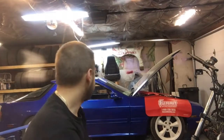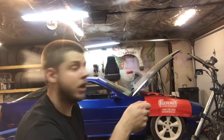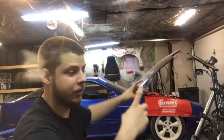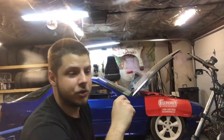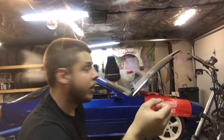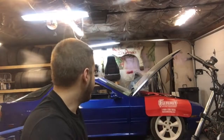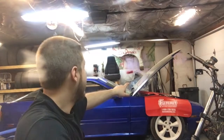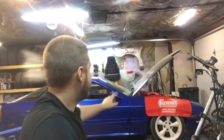Everybody was hung up on the power wire. The power wire runs from the inside dash switch all the way out and around to the factory red jump block, then underneath the car to the starter. What I did was run it directly to the starter — shortened the wire by four or five feet. It was thick gauge, thick strand wire, totally able to handle the voltage and amperage. So it's just a lot shorter from the battery to the starter now.